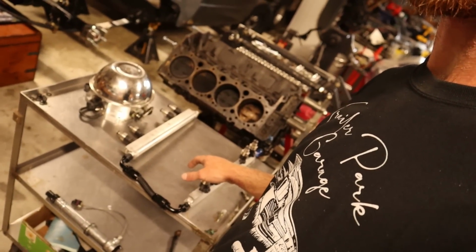We'll put the fogger on it, all the injectors. But before we put the injectors on it, we need to take them to CAPS's because we need to flow them. They might be fine. They may not. Number two is still up in the air, could be an injector problem. We need to figure that out, and fast. So, that's our plan. We'll run up to CAPS's today, in the midst of all of this, we'll flow the injectors, and we'll go from there.